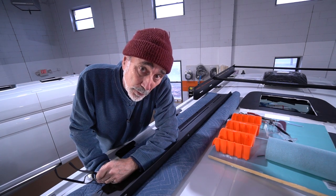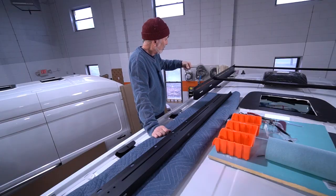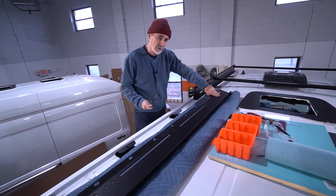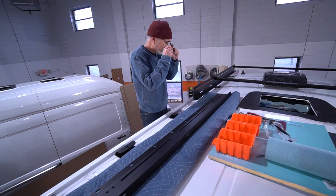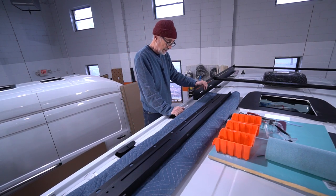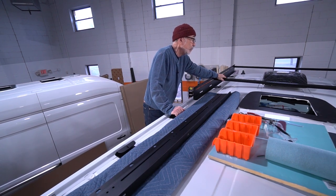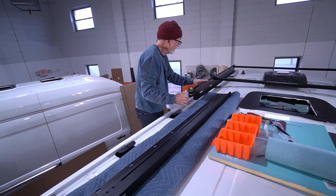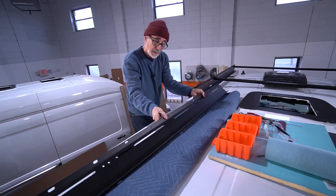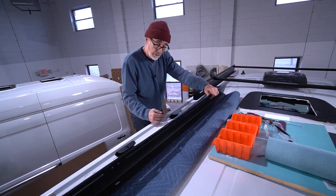I've got the entire front half of the rack assembled on the roof — the full length of the passenger side, the two side pieces, and all the brackets. I'm now doing the back half on the driver's side to show you how it's done. I assembled the front half of this side rack — it comes in two pieces — and put in a couple of crossbars so you can see how this squares up. I recommend: torque down your brackets with Loctite so they're locked in, but keep the rest of the rack loose. The width of these crossbars dictates where the side rails fall on the bracket. The holes are oblong — ovalized — wherever you need them to be, both in the bracket on the roof and in the side rail. A lot of mobility — very good engineering.